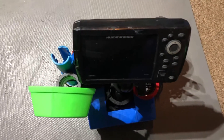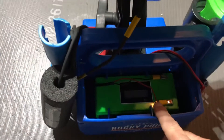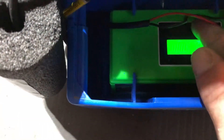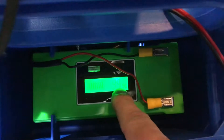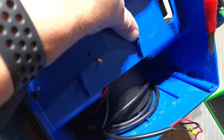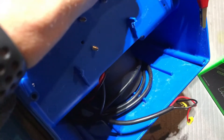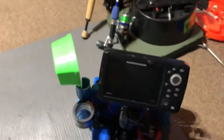Here's my little setup in the back of the box. I did have to cut the little brackets back just an inch or two to make room for it. It's got a handy little screen that tells you the percentage — it's at 99% right now — and it's even got USB plugs so you can charge your stuff. Just a note: the battery is a little bit taller than a regular battery, just a fraction of an inch, and I had to take a hacksaw to the brackets just a little bit to make it fit. No big deal — about three minutes of work.